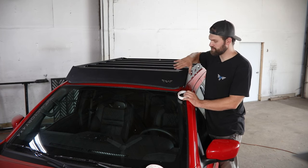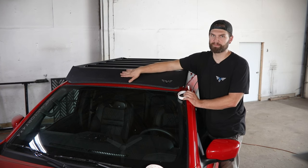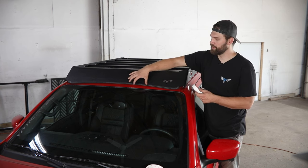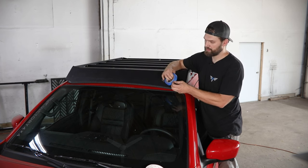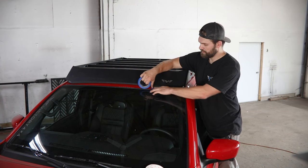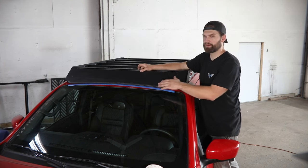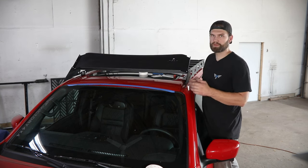When adjusting the fairings, you want to use the slotted mounting holes on the side to press this down tight to the roof so that you don't get any vibration or wind noise along the front edge. Before you actually tighten it in place, we're going to recommend installing 3M paint protection film along the front edge anywhere that this edge lock trim contacts a painted surface. To do that, we recommend pushing the fairing all the way down tight to what will be pretty much its final location. Then mark out using some masking tape about an eighth or three-sixteenths of an inch in front of that edge lock trim — you'll use that as a guide for where to lay that paint protection film. With your tape line marked out, you can then either remove the two front bolts and flip this up out of the way or completely remove it. You'll then want to clean the entire surface anywhere you're going to be laying that film with a residue-free cleaner — I just have an alcohol prep pad here, but rubbing alcohol on a clean microfiber works just as well.